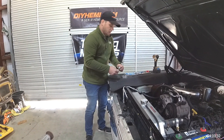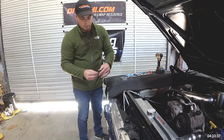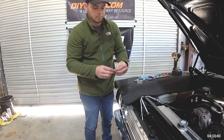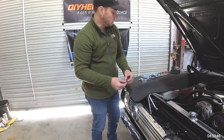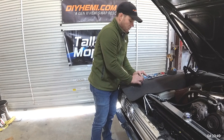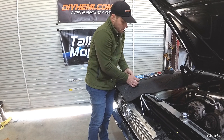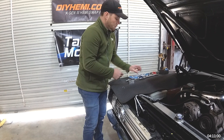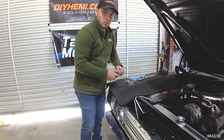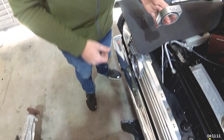First thing we like to do is place a little bit of white lithium grease on the O-Ring, just because we don't want any cuts or pinches. We want it to be really nice when we install it. I'll put a little bit on here and run it around the entire O-Ring just to keep it from getting pinched. Then roll it around the register and press it down into the O-Ring gland. The beautiful thing about this is there are no cork gaskets and no RTV needed for this installation. It's pretty much a bolt-in at this point.